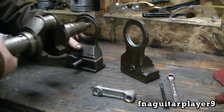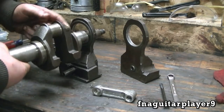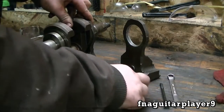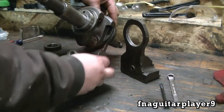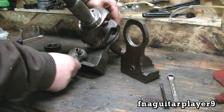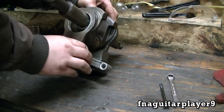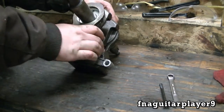I'll be using this in an 11 horsepower eventually - they're sitting over there. Also, when you put these back together be sure to load this up with STP or motor oil or something - even grease should probably be all right. Then make sure you put this in facing the right way. If you put it in wrong like this it won't go in all the way - make sure it goes in like that.